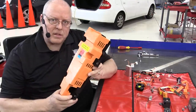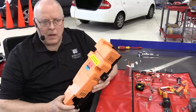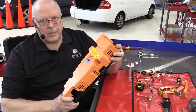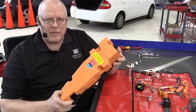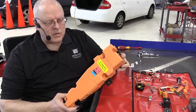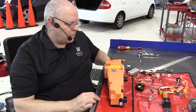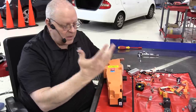All right, in the front of this battery is the high voltage battery disconnect relay center, also known as the battery disconnect unit. Unfortunately, this entire assembly, if anything goes wrong with any of the four contactors inside, or the resistor, or fuse, or current sensor, you have to replace the whole thing, from what I can tell. I could be wrong, but I cannot see any procedures in the GM service information to replace anything inside of here. It's just the entire assembly, which is kind of strange, because on the Volt, you can replace individual pieces. It's quite nice, actually. But that's just how it is.